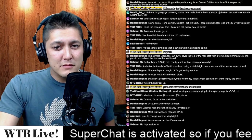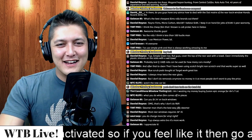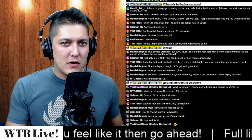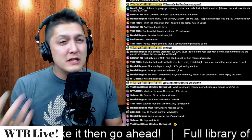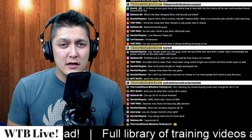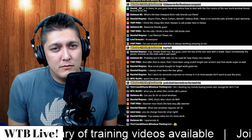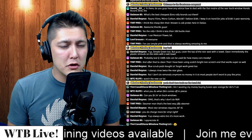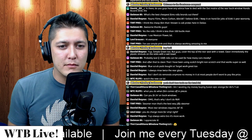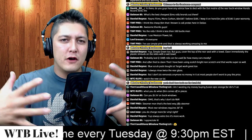What do you do when film comes off in pieces? You pray to the tint gods that you're not going to be there for 4 hours. When it comes off in pieces, listen, most window film has a life expectancy of about 7 years, give or take. And it really just depends on where you are. I live in Florida, where good film goes to die. So I've seen Llumar and 3M film crap out in 3 years, and the same film north of the Mason-Dixon line, in New York, Chicago, Michigan, that will last 25 years and never have a problem. So usually about 7 years is when the film is like a rubber band, right?